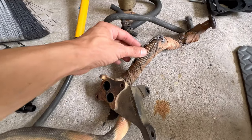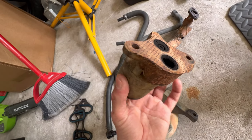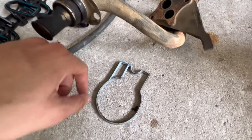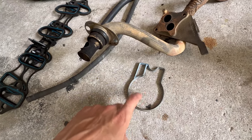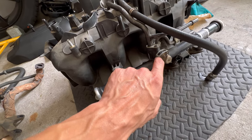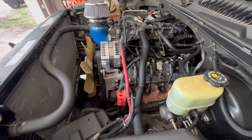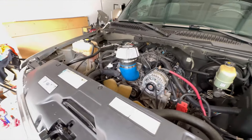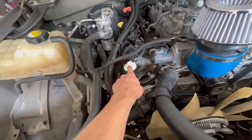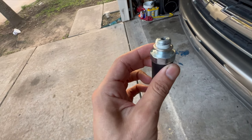So I'm going to go ahead and block that off — I'm going to have them weld it closed and then bypass the EGR and find a plug to close the intake from here. I know there are factory manifolds that don't even come with the EGR, so I'll look around for a plug or buy a used one. The Yukon's EGR was in better condition but once I put it on the studs broke off, so that one looks more beat up too. I also went ahead and ordered another oil pressure switch just to make sure — it keeps doing that low oil pressure reading — so I'm about to put it on and see if that's the fix.